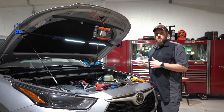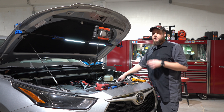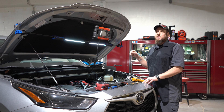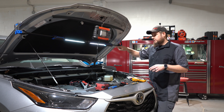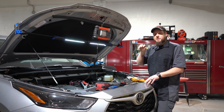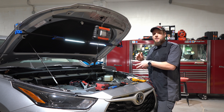Once you've found your fuses that are pulling power, go to the wire diagram book and figure out if they're related. For example, say there's a 30 amp radio fuse with a 0.003 pull, but inside there's an amplifier fuse at 0.02. You look at the wire diagram and figure out the amplifier is glitched, stuck on, pulling power and sending a signal to the radio to stay on. A mistake guys make is just pulling the radio fuse, seeing it drop, and thinking it's just the radio — when in fact the amplifier is commanding the radio to stay on.